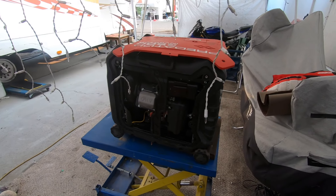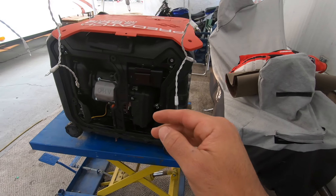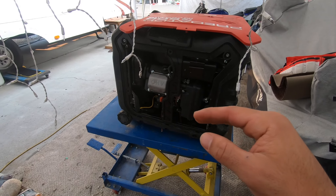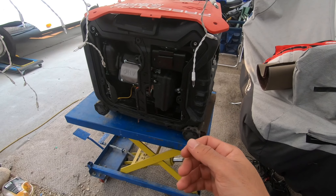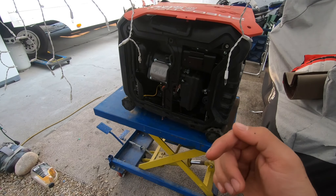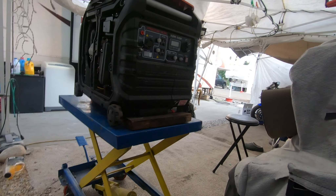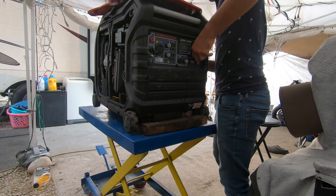Okay guys, it's day number two. I literally got tired of pulling the pull cord and taking the spark plug out, cleaning it, checking the gap, and checking for spark. I tried and tried and could not get it to start — it coughed a couple of times but never ran. Yesterday after waiting, I came outside after it had sat for three hours, gave it one pull, and it started right up. I think I had it flooded. Sometimes it's just good to leave it alone, let your frustrations go away, and give it another try.